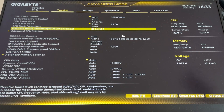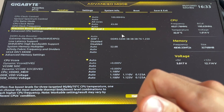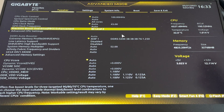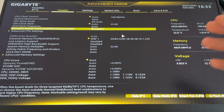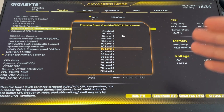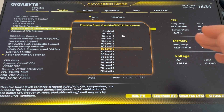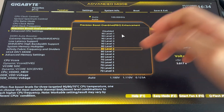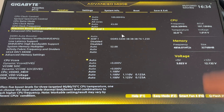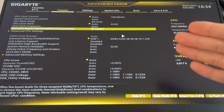For the first option, you just choose 80 level 2, hit F10 to save, enable your XMP, and you're done — you'll enjoy better performance and a better-running CPU. But if you want to experiment a bit, I'll explain how to test further. The higher the number you can input, the better — so if you're lucky enough to run 80 level 5 that would give tremendous performance improvement, but that will only be stable for a very small percentage of users.